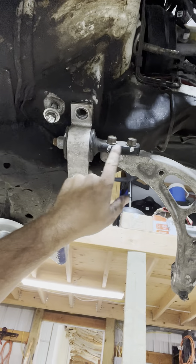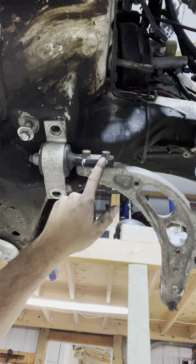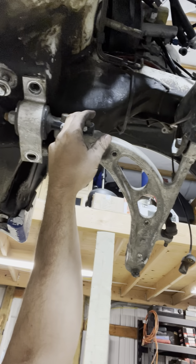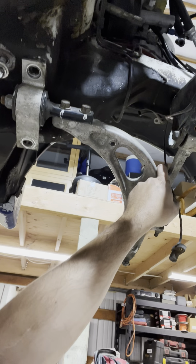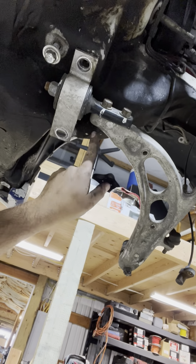Initially I might end up just notching it, but I don't really want to do that. I'm trying to figure out if I need to create another piece here — if I make this part with the holes in a different position, or weld this one up entirely since it is steel, and then redrill the holes to take the offset out. That might be the easiest way to do it. Or I could try going to the 15 control arm, but the rear mount is totally different and the control arm goes wide sooner and hits the frame. You'd have to smash the frame rail to get the control arm to fit, and I don't want to do that. Building a full custom control arm is an expensive fix, whereas just modifying this one piece would be relatively cheap.